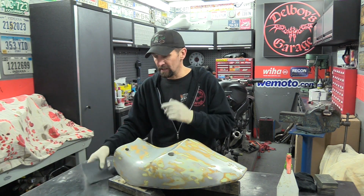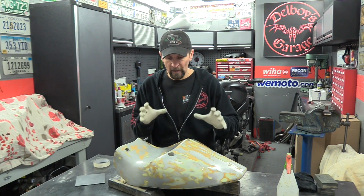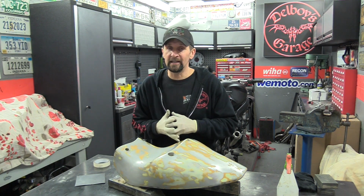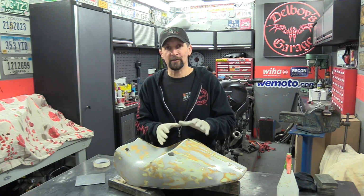So in this instance, I'm going to use the 1000 grit because I've used it in all the other pieces of bodywork. It's not been any problem at all. And for those who might think that then you don't get a proper key to the paint and it can lift off in the future, well, I've never had that happen. I've been using tough paint for many years, been okay so far. If I find that it is, then I'll modify my approach towards it, but it works. 1000 grit is absolutely fine.